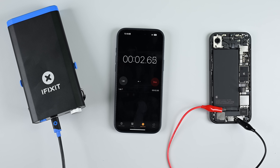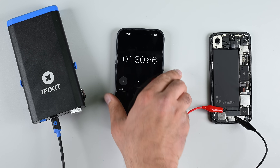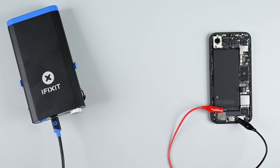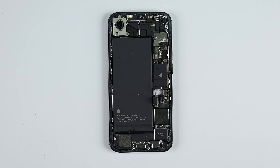According to Apple's iPhone 16e repair manual, which you can find online right now, I need to apply 9 volts for 1 minute and 30 seconds. You can go as high as 30 volts and we demoed a 5-second release using 20 volts in our iPhone 16 teardown video. The iPhone 16e battery is rated at 15.55 watt-hours while the iPhone 16 is rated at 13.83 watt-hours. The larger battery is possible because of the space opened up by the 16e only having a single camera module, rather than the dual camera module found in the iPhone 16.